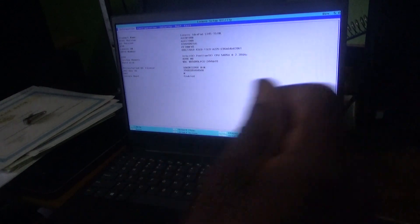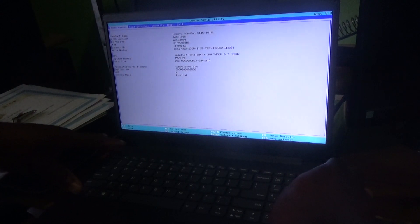Press the power button, then once you press the power button, keep your hand on the function button and continue pressing down on F2. So as you can see, we're now in the BIOS. Press the power button, then press and hold the Fn key while continuously pressing the F2 key. That's how you get into the Lenovo Setup Utility, also known as the BIOS.